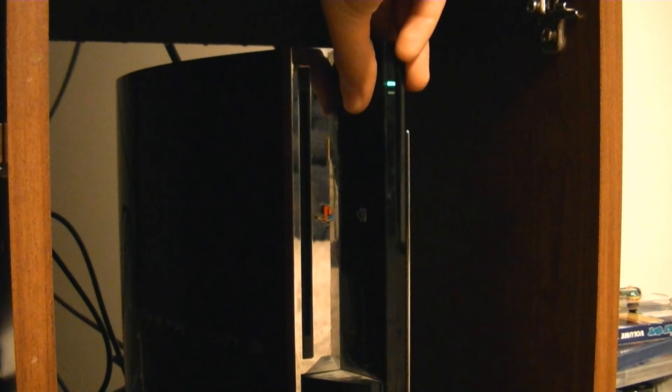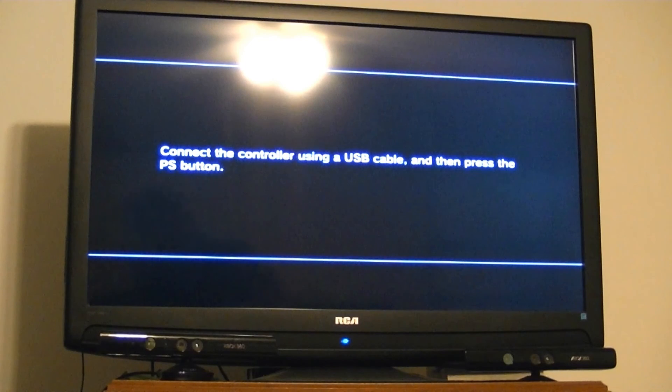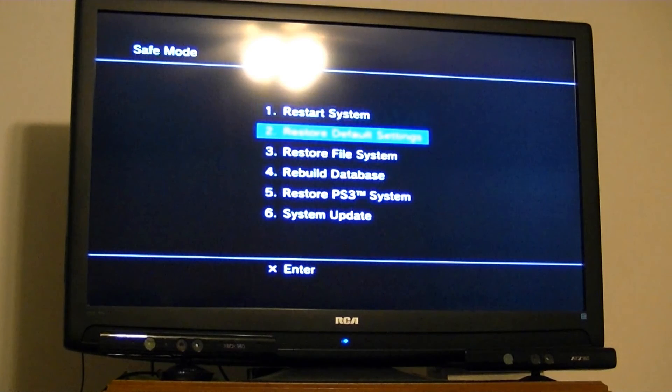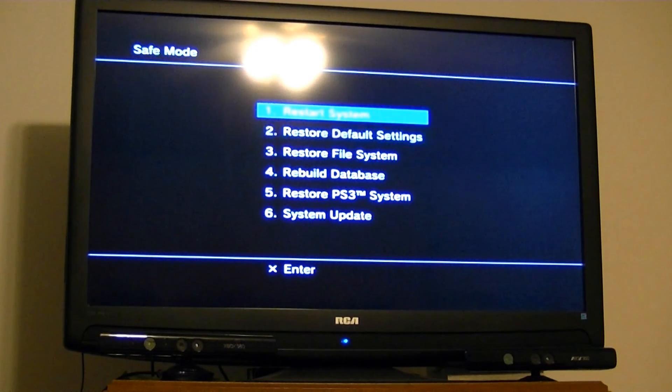After that, you want to boot it up again. Now hold it down again, but wait for one beep and your green light will flash. Now wait for a double beep, and when you hear that double beep, immediately let go and you should be good to go. So once you do that, you can just hook up your PlayStation controller, press the PlayStation button, and you should be good to go in recovery mode. Now most of the time this is used if you are installing a custom firmware or whatnot, but it's always used as a recovery mode since that's what it is, so you can always utilize it for anything.